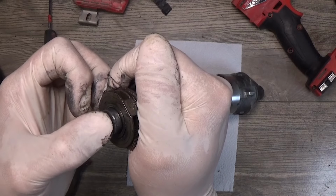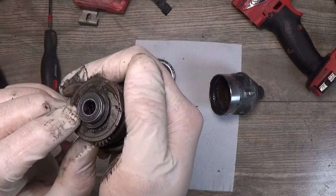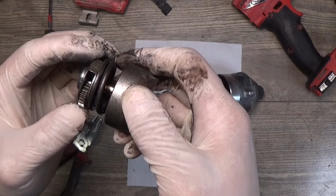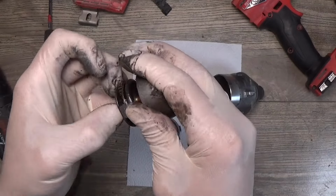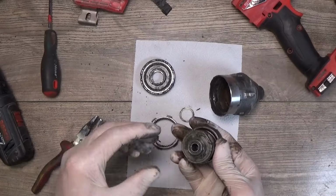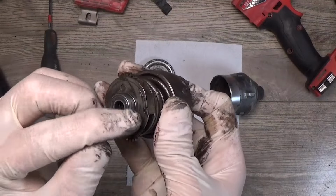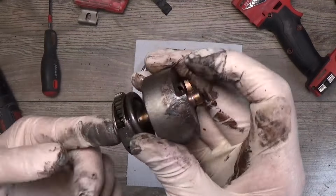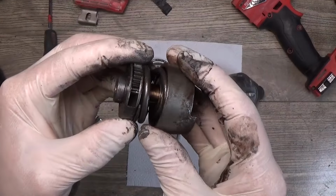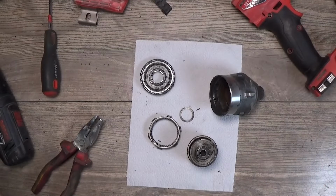Okay, this is moving. So maybe press it in. Yeah, it's moving. Okay. And yeah, it's not a bearing, it's a housing for the bearing. This bearing is moving. Of course, the grease is overheated, that can cause problems. And we need to disassemble this one.